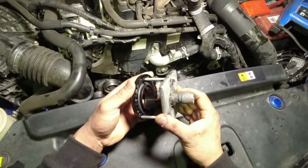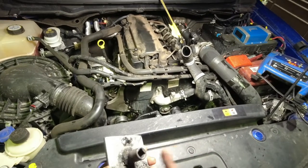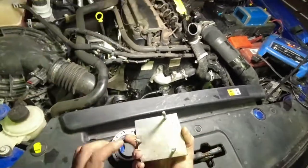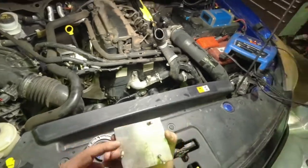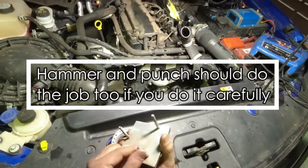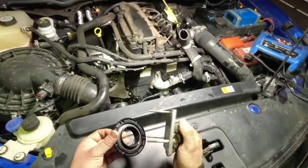What I did was make a little tool. I put three bolts of the same length into those three dimple holes, put a ratchet on there, and you can turn it clockwise or anti-clockwise. I welded up an old socket so I can fit my half-inch ratchet. It's basically a flat piece of metal — drill three holes, measure the distance, and put some bolts in — I think 10mm head, about 6mm thickness. Then weld something on so you can use a tool to turn it. That's basically it.